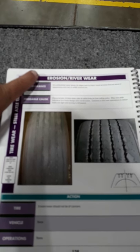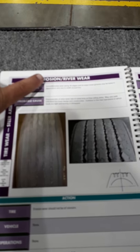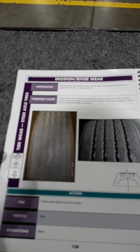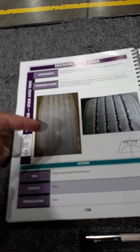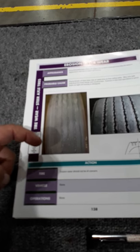It's amazing how many different things can cause all these different types of tread wear patterns on tires, so we have to refer to a service book. I have this book here put out by TMC — it shows a picture and helps us identify the wear, and it tells us that this is erosion slash river wear. The reason I refer to the causes is it tells me what causes that wear, and more importantly, it tells me that this particular wear pattern on this front tire should not be a concern. It tells me why it wears that way — it's a natural occurrence for this type of vehicle and application — so no actions are needed.